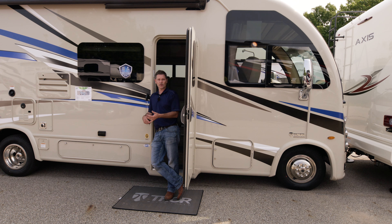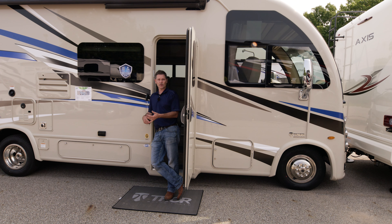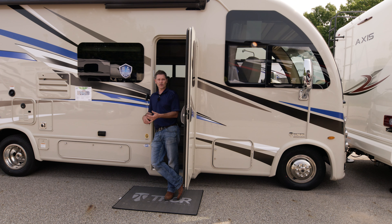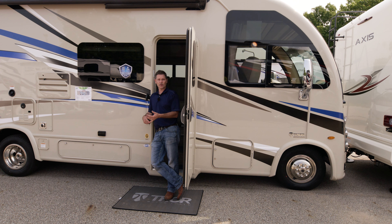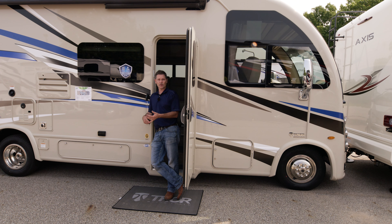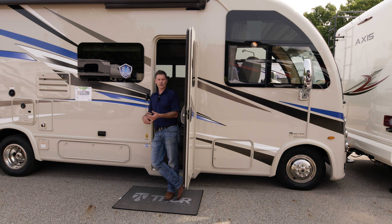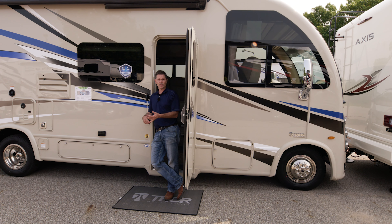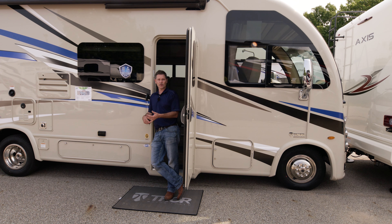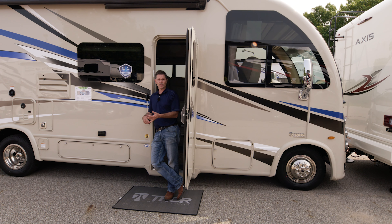This is your propane tank. You have an on/off valve, a gauge, a bleeder valve, and your fill valve. You can get this filled anywhere they fill propane — the same place you get propane at the hardware store. The first time they fill a new tank, they'll purge it because there's air in it, so it'll take a little longer. On your travels, check ahead if you're going through bridges or tunnels — many do not allow your propane tank to be on. But otherwise keep it on because you need it for your water heater, cooktop, and furnace.